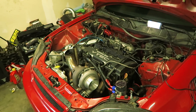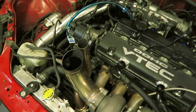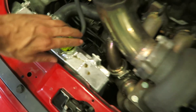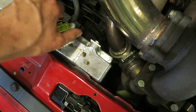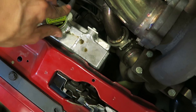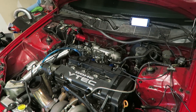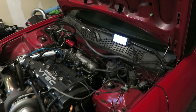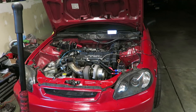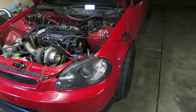All the other ones look okay. It just seems to be that one, and that would explain why it was blowing coolant out — or actually it might have just been burning a whole bunch of oil, because there's actually quite a bit of coolant left. The smoke was really white and it smelled like coolant to me, but maybe I didn't realize in the moment it was actually oil burning. It's pretty hurt. Gonna have to pull the motor back out of the hatch again unfortunately to fix her.